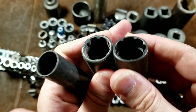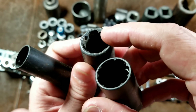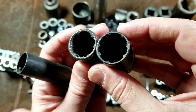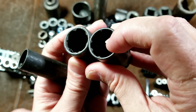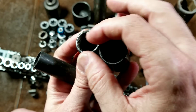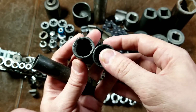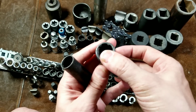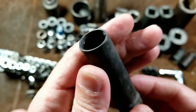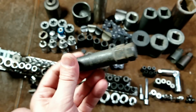One thing that they do try to do with the security lug nuts that use the tooth, or what I call asymmetrical spline design, is that they have all sorts of different patterns, and you can see there's subtle differences. Like, this has a double there, this one has no double. And that's something to be aware of, is those external spline types where the splines aren't evenly spaced. That actually acts like a specialty key and prevents just one socket from fitting everybody's security lug nuts, which has always been kind of the criticism of these Gorilla lug nuts. They're really nice because they fit in the tight spaces, but they're just one common style.